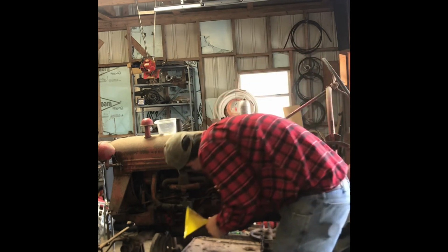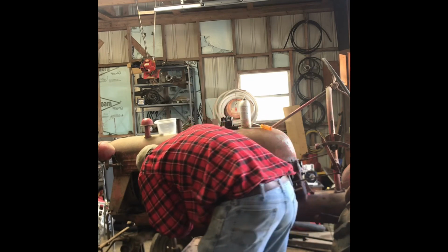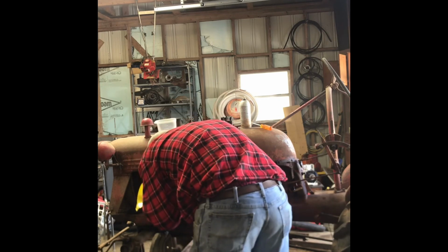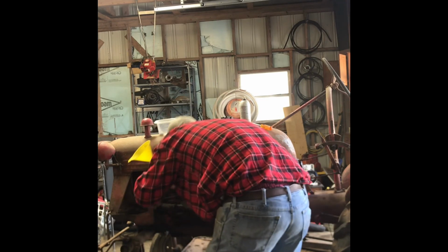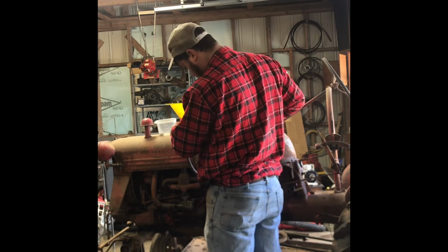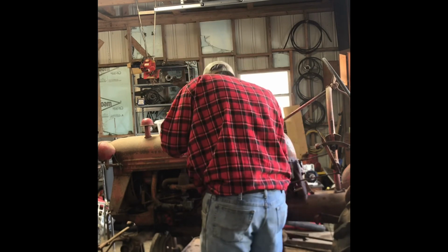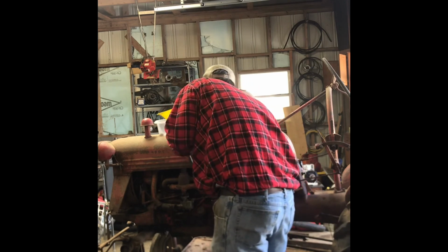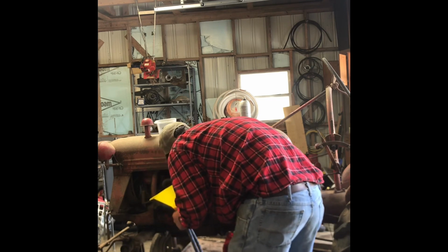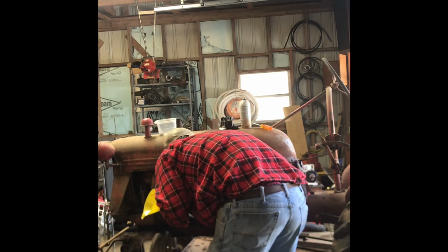You take that hose, put it down in the fire hole on top of the motor. If it will fit, come on, show me the way. Come along with me. There we go. Now you install your Marvel Mystery into your engine until it pours down the side again. That cylinder is pretty well full. And so on, going down the line.